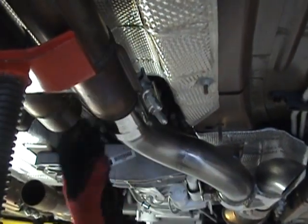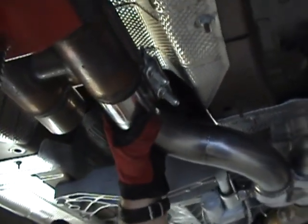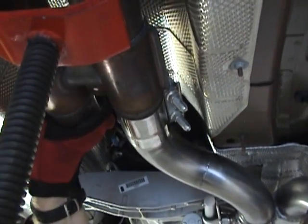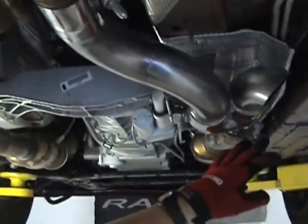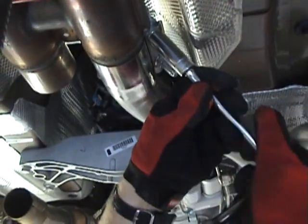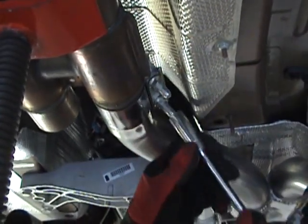See how long these become after you start clamping them down. I'm not going to completely lock them down tight yet — I want to get the other side together first. I'll loosen it up, get the other clamp in, get the exhaust where I want it, then clamp them both down. I am clamping the front down tight to keep the orientation where it's supposed to be. For now I'll just loosen these up a little to give some freedom to move.